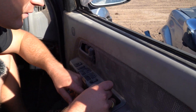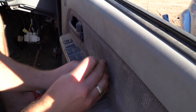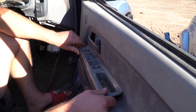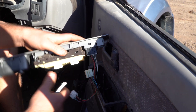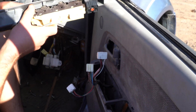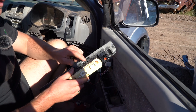Phillips head screwdriver straight into this hole here. You've got two Phillips head screws holding this little door card — basically your hand grip to pull the door shut. Once you've got those two screws out, you can just rotate around, unplug the plugs — one and two — watching that you don't lose your screws. Pull the whole thing out so you've got heaps of space to work on it. Once you've got it out of the door, bring it over to a workstation so we can begin pulling it out of the shroud.